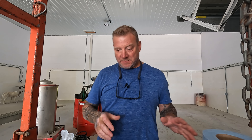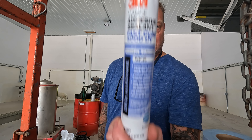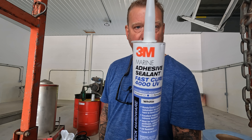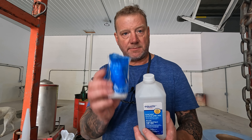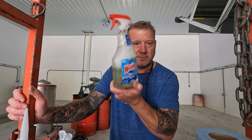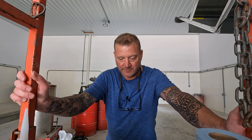By no means am I an expert at this, so you're going to have to bear with me. What I'm using here is the 3M 4000UV - this is the stuff they recommend. I've used this stuff before and it's a really good product. What I'm going to do is when I come up to the area I want to repair - the camper's all washed - I've got rubbing alcohol and some pads to clean off the area before I apply, and then I have some soapy water. After I apply the bead, I'll give it a quick mist and when I wipe it with my finger it shouldn't stick. Again, I am no expert at this.